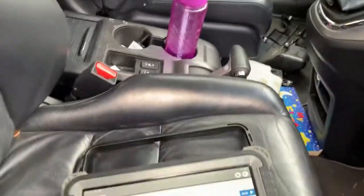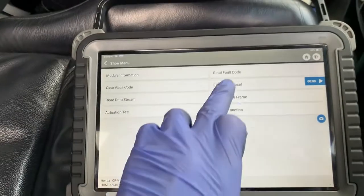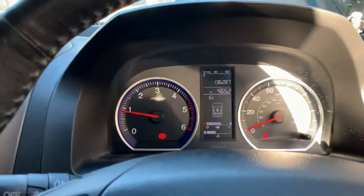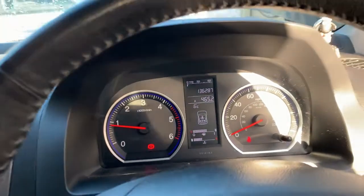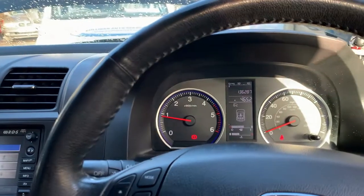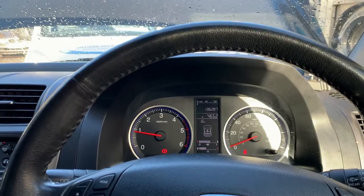We'll remove our amp clamp, go in the cab, and clear the faults. So we've cleared the faults and we're just going to let it run. The warning light is off right now, but the battery is getting quite flat so we'll let it run. Once we're able to shut it off knowing the battery has got a bit of charge left in it — we're looking good. No warning lights are on the vehicle. Stopped and started it a few times — the reoccurring fault that would happen after about four ignition cycles, the warning light would come back on. Now it's resolved.